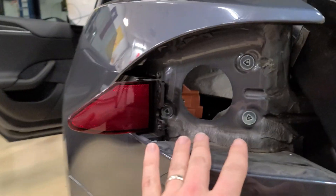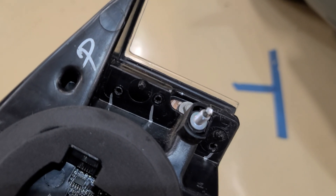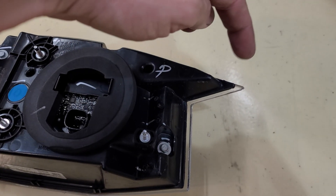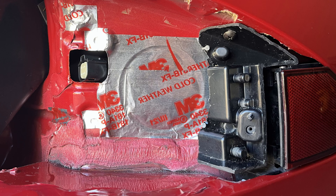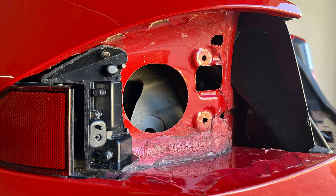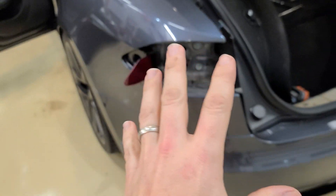Like we saw earlier, we did remove this light, and here kind of comes the problem. This needs to be bolted into something. So I got one of the old screws — this was originally bolted into the tail light in those three holes. Now there is nothing to hold it into place. What we essentially did is cut this out around this area enough that this stud still goes into place to hold this assembly, and that allows you to put the three screws back in. So you will have a little bit of your old tail light right here. We also need to make the hole here and a connector hole, and then it just goes into place. We went ahead and waterproofed everything with some tape, and that fixes up the tail light into place.